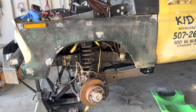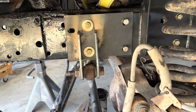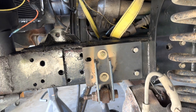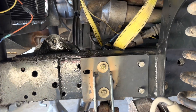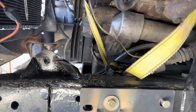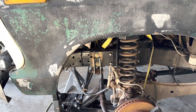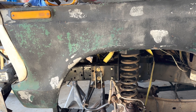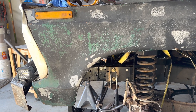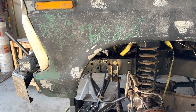Since the last clip, we got the coil springs in, I've got the axle centered, and I went ahead and tack welded the track bar mount in place. Now I just need to remove that bolt and those four bolts and start welding it in. I wrapped a ratchet strap around the bottom of the track bar — it goes all the way over there — ran the ratchet up and over here to pull it up into place, got it where I wanted it with my hand, and did a few tack welds. Now I'll remove the ratchet strap, remove that nut and bolt, and go ahead and weld it in.